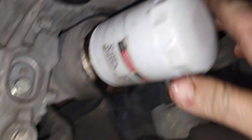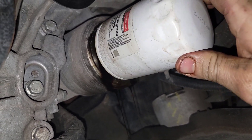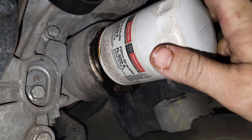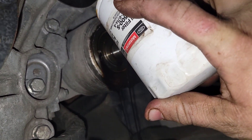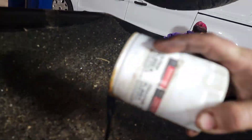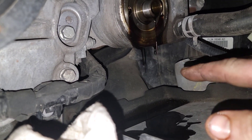After cracking it loose I slowly continue — pull the filter back as much as possible, then slowly tip it down and let it drain out the back side. There you go — you don't make a mess all over the front of the truck. Then you can take the filter and finish dumping the rest of it down here. The tray stayed nice and dry up front where it always gets messy and leaks out.